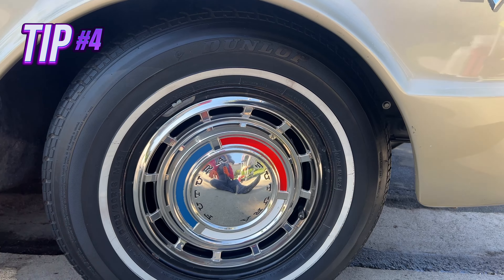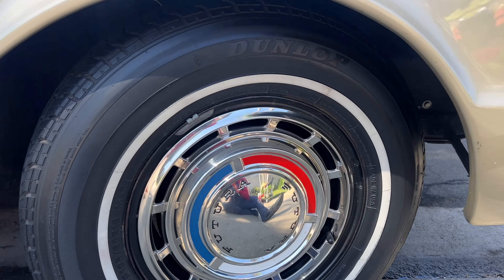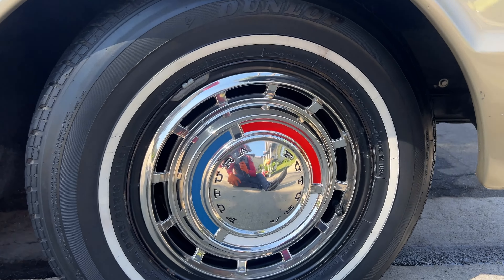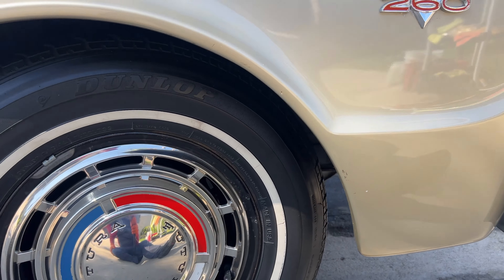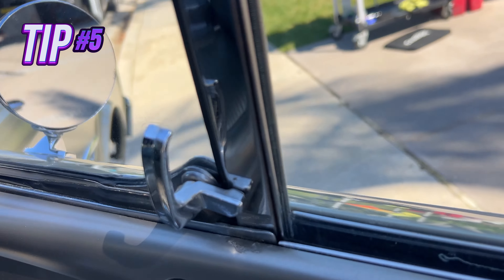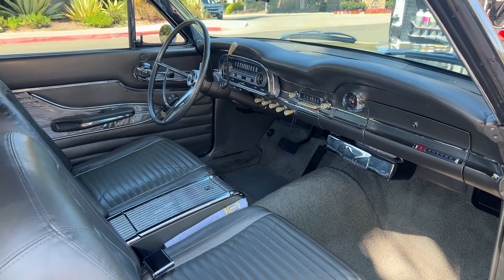Another thing is cleaning the wheels and tires. As mentioned, you don't want to use a strong cleaner because it can fade and mess with the white wall — it can cause damage and smear all over the tire. I would also try to stay away from water-based dressings. You can use them if you just use the lightest spray to give it that sheen — just a nice new tire look, not shiny, not glossy. And be careful with anything that has hinges, like windshield wipers or window pieces. Everything is vintage, so be very delicate when cleaning anything — no strong cleaners.